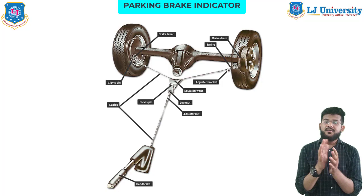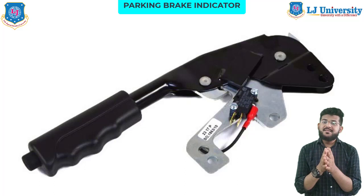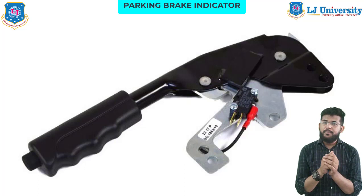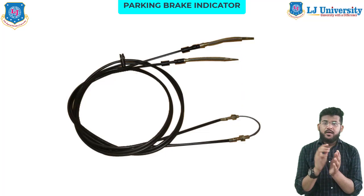There are different common reasons for this. First is a faulty switch. One common reason for the parking brake light staying on is a failing switch. This can be checked easily by moving the handle to and fro after it is down. If the light turns on and off, the switch is most likely faulty and needs to be replaced. Another reason for the light staying on is the brake handle not being completely lowered. Double check that the handle is all the way down and that the parking brake is fully disengaged, as any pressure on the parking brake cable will cause the light to stay on.